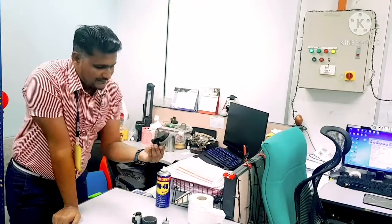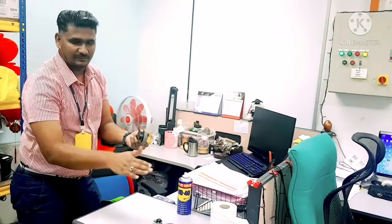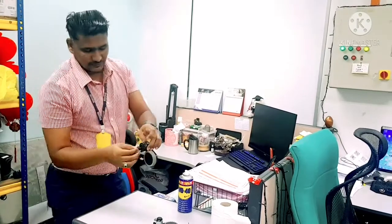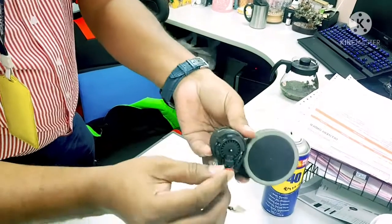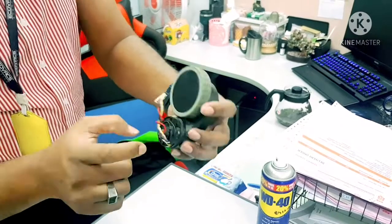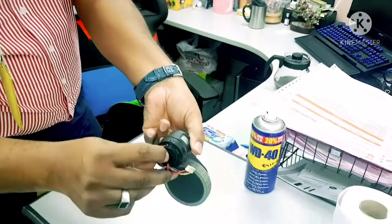In this model, it was not the gears that were stuck. When I opened the Deebot I found that there is a sensor on the wheel, and every time the robot goes over carpet or bumps up and down, the wheel moves. Because this customer has been using it for over one year with constant up-and-down movement, I found two wires — negative and positive. The negative was okay, but the positive wire was broken right here. That's all — the wheel, gears, motor, sensor, counter sensor, motherboard connection — everything else was fine.